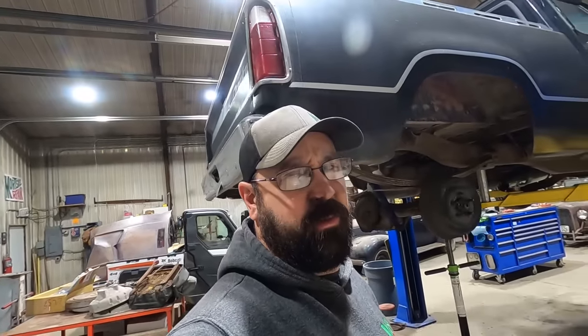And there you have it, according to the camera, what, 30 minutes in, get everything dropped down. I like heating up them U-bolts because that way, hopefully, you can save them. You can cut them with a cutoff wheel if you don't have a torch, but torch, really good investment. It's something you'll have forever, and you got so many uses with it. You can heat with it, you can weld with it, you can cut with it.